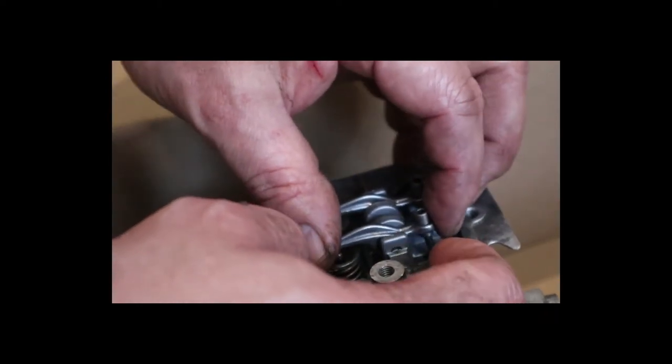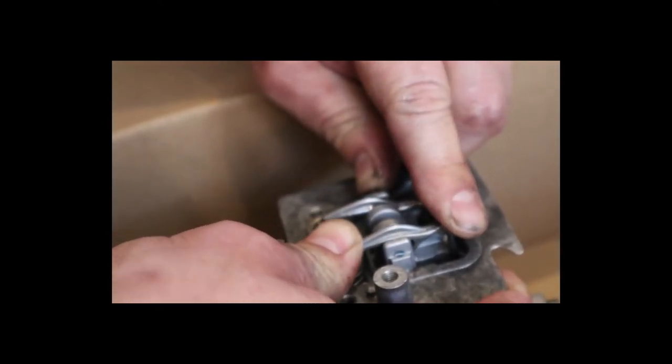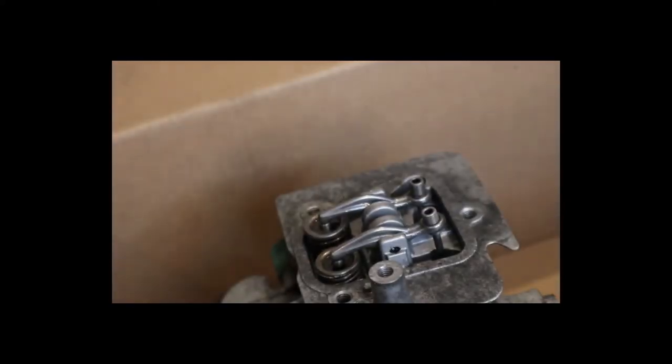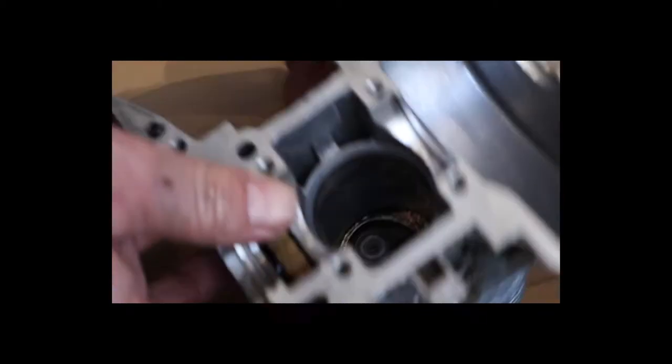The problem I was having — I picked this up from my mom. This has been in the family for probably 20 years. I really just wanted to fix this thing because my mom and dad used to garden, and everything I know mechanically is because of my dad. What happened was the exhaust side was taking on water over the years. Sitting wherever it was, even though it was inside, the moisture crept in and rusted the exhaust side shut — or open — whatever. There was no compression.